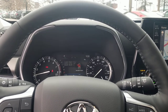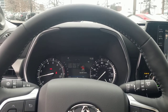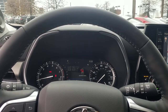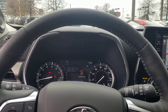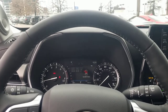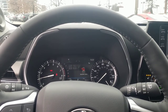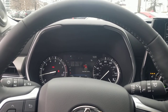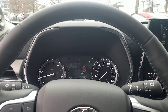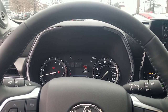Also, so you know — the lesser models like your XLE do not have the kick on them, and I don't believe it's an option on those. I think it's just the Limited and the Platinum, but I could be wrong. However, you still have the ability to adjust your door the exact same way I just showed you. If it has a power back door, that is the way to adjust it — whether or not you have the kick, that is your adjustment on the back door.